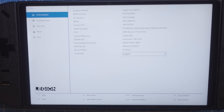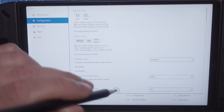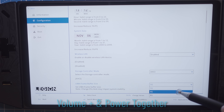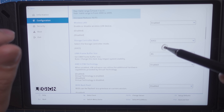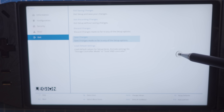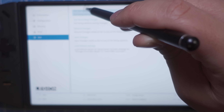The last software tweak is setting the VRAM in the BIOS. To get to the BIOS, turn off the Legion Go completely. When turning it back on, hold the volume plus button as you press power — that brings you into the BIOS. Go to BIOS setup, then more settings, configuration, then UMA buffer size, and you can set this to four gigabytes. A lot of people have been requesting six gigabytes, which isn't currently available in the official BIOS but is coming soon. It is available in a beta BIOS, which I don't recommend going out to get, but it does work at six gigabytes VRAM.